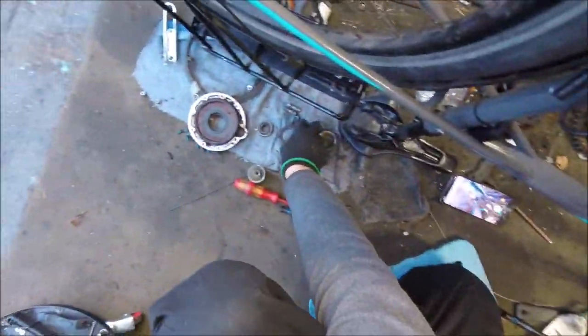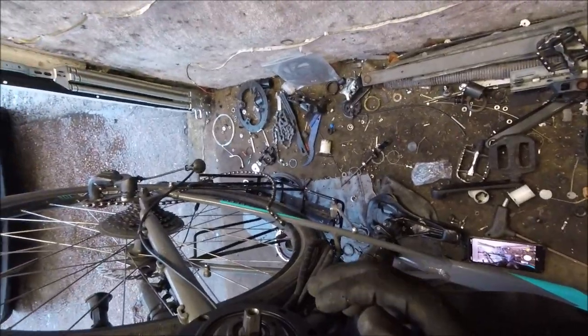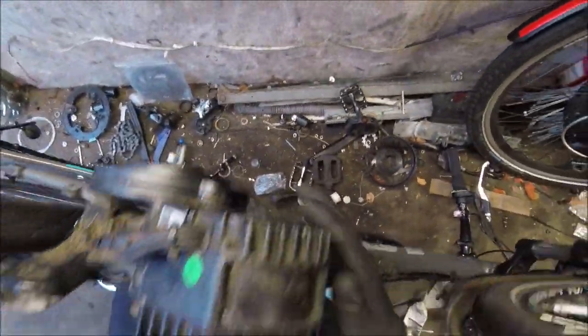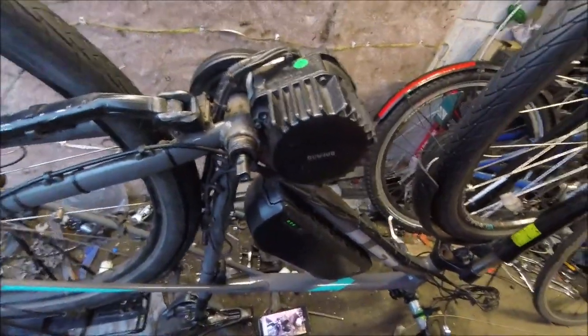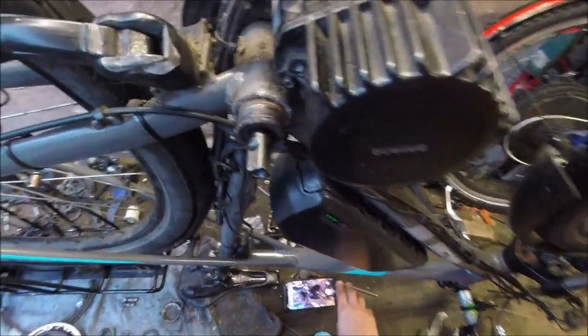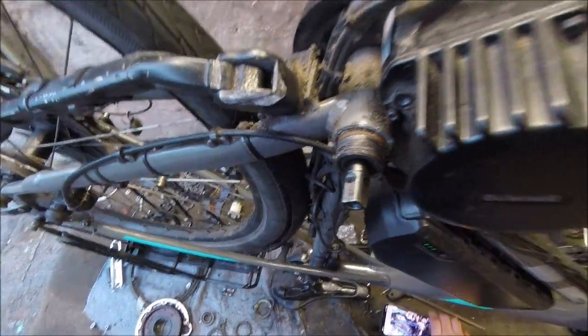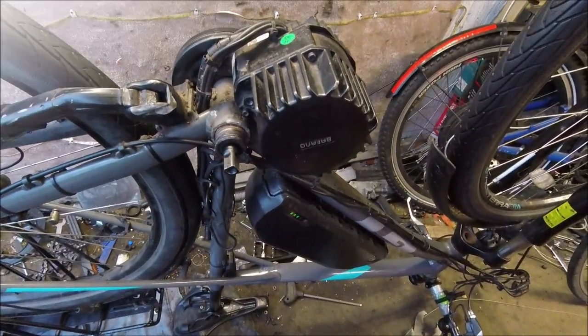Put this back piece on that holds it steady in place, bolt it in there, put the gasket back in, the cranks on, and that should be it. I hope that's solved some people's problems, because I couldn't find it anywhere else online. This is a 1000 watt motor, so I presume it'd be similar for the other ones. Thanks for watching — see you next time on MarkCycleRepairs.com.